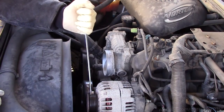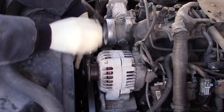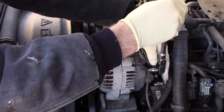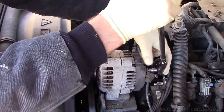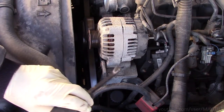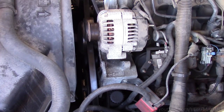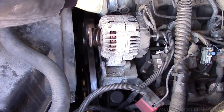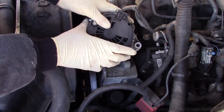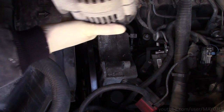This is probably one of the easiest alternators to do — it's got like two 15 millimeter bolts holding it in and that's pretty much it. On this Silverado, there's a 10 millimeter nut that holds the alternator B plus lead on — go ahead and loosen that. Also going to take a prybar to give a little bit of assistance getting this out of the bracket. For the alternator connector, just pull up the little tab and pop the connector out. And there she is — she's out. Probably one of the easiest alternator jobs you've seen on this channel.